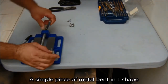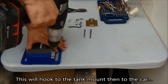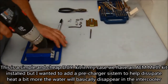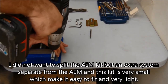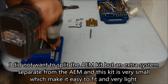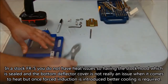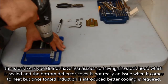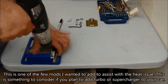The reason I'm doing this is because of excessive heat in the FRS. The hood is sealed on the bottom — it has a metal plate on top with rubber seals around it. When your car is stock that's okay because it was made with those specifications in mind, but once you add a turbo, supercharger, or any modification that ups horsepower, you get more heat locked up inside since the hood has no ventilation.